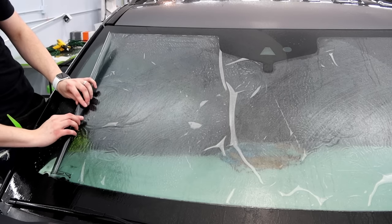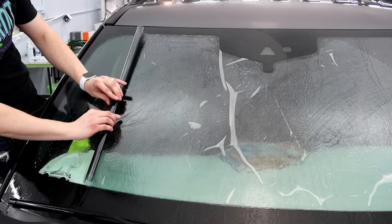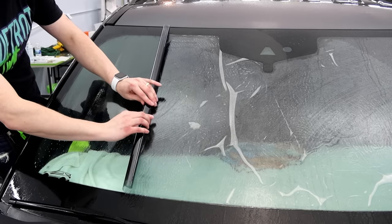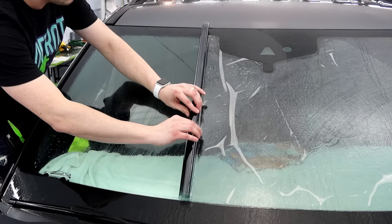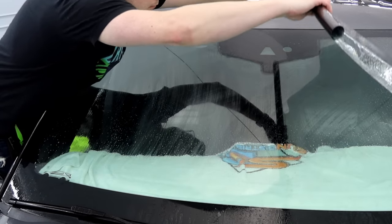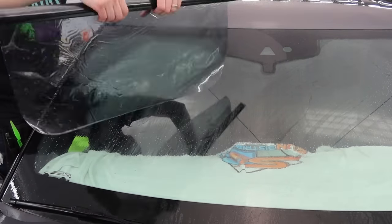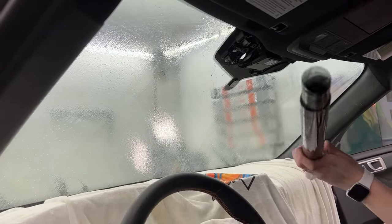I like to start on the passenger side of the car — the first side to be rolled up is the last side out. So if I'm going to end on the driver's side, I want to roll up the passenger side first because the driver's side would be the first bit to get unrolled. You want to keep as tight a roll as you can, and once I get to about halfway I'm going to continue rolling up the entire film and get that roll as tight as I can — but don't sweat it if it's a little bit bulky.